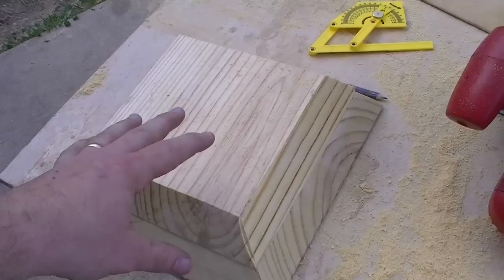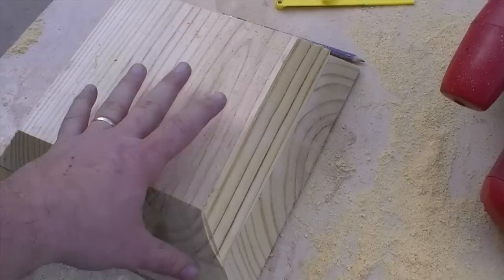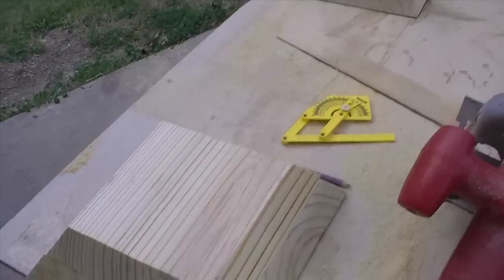I'm not going to get the seat swivels because there's about 4 different kinds, and whoever buys this boat, I want them to be able to make that decision. So we're going to put a piece of 3/4 inch that is the width of that little seat swivel. The pedestal itself will be this, and this will be glassed in and gel coated and everything. But in between this and the seat will be a piece of 3/4 inch treated plywood that is a spacer that takes the place of that swivel. I just don't know if somebody really is going to want a swivel for this boat, so I figured that's the easiest way, and if they want to, they can take it off, put the swivel on, and call it a day.